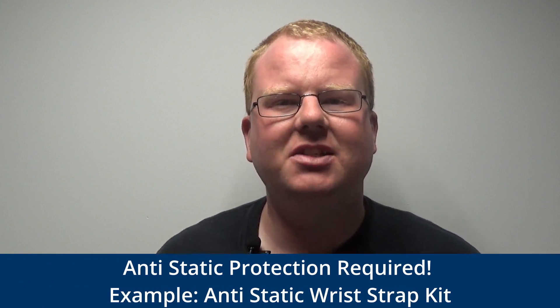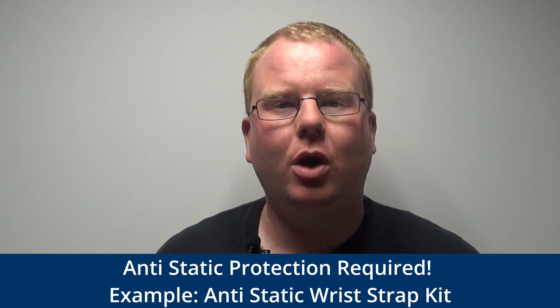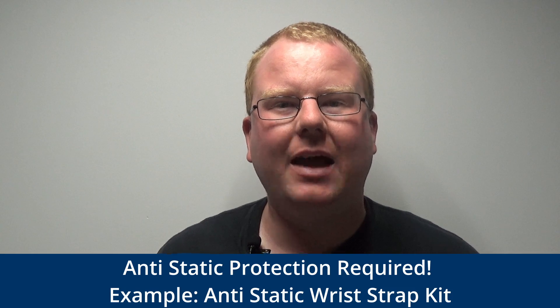Well, on occasion when you are transporting a computer through the post, sometimes the RAM modules may partially come loose or dislodge itself. Other reasons is so you can troubleshoot why your RAM is not showing up in the BIOS. What you need for this video is an anti-static wrist strap so we don't damage the RAM and other electronic components from static electricity that we may discharge.